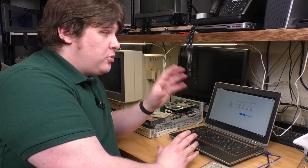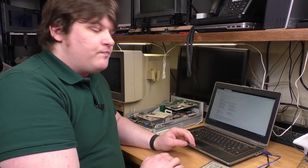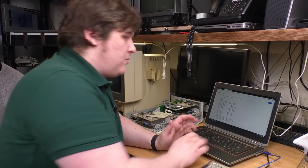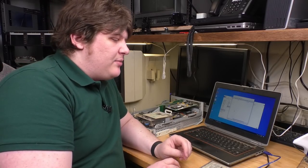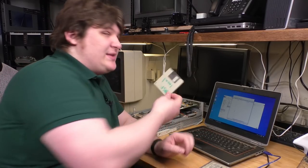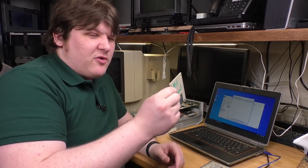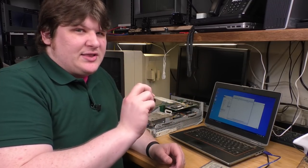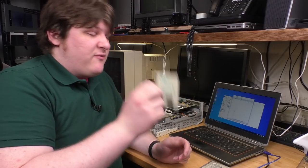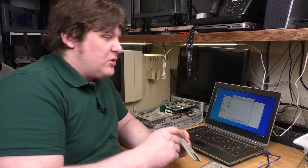I'm also going to be using WinImage, which is the premier Windows floppy imaging program, which I got a license for and then lost, and I can't find it anymore. Another nice thing about this Dell floppy drive, I don't know if it's true for all USB floppy drives, probably is, but it honors the density select window. So this hole here that tells the drive whether it's a 720K or a 1.4 meg disk, it'll honor that. So if you put in a really old disk, it will actually get the size correct. Although this one actually is 1.4 meg. I think by the late 80s, nobody was using 720K anymore, but don't quote me on that.